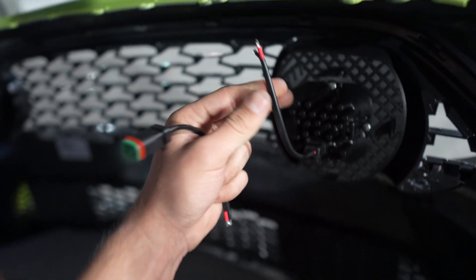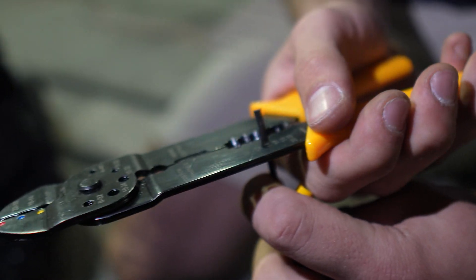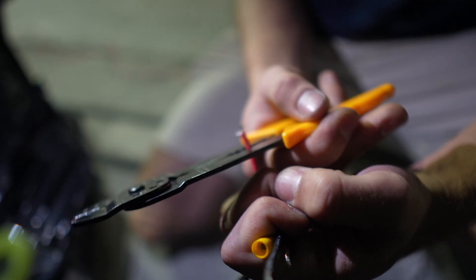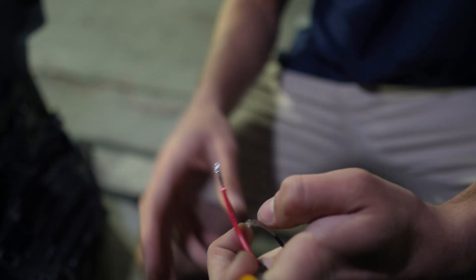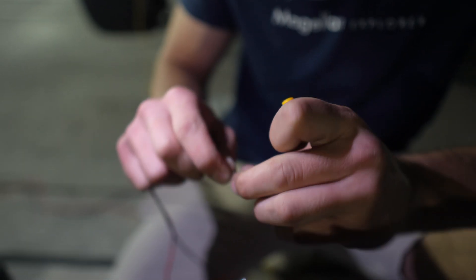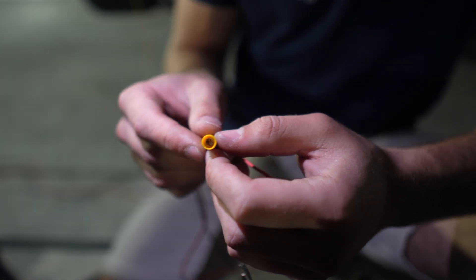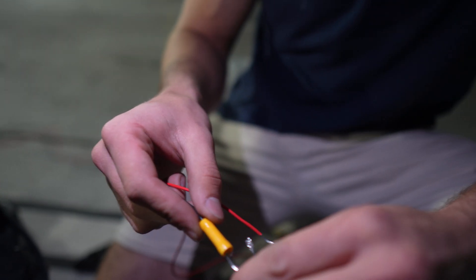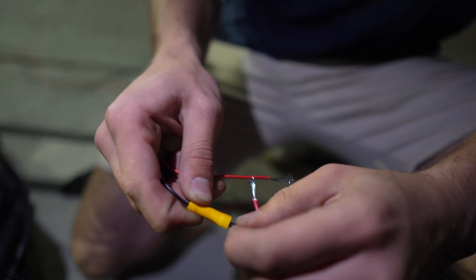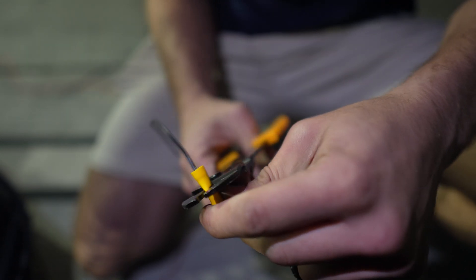These are female two-pin connectors that go into the lights just like this - those pop in. Then we have to run these down to where we tap for the turn signals on the headlights. I'm stripping the wire on the pigtail connector - there we go, perfect. I'll do the red one too. Now I'm going to use heat shrinks and connect these black and red wires to the pigtail connectors. You shove it all the way in and they're going to touch in the middle, then close it with the crimp tool. Make sure you don't over-crimp it because it will cut through and disconnect.